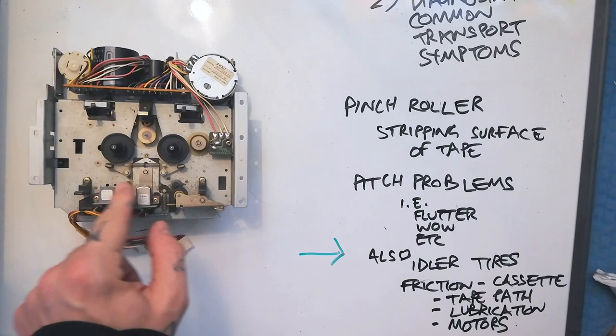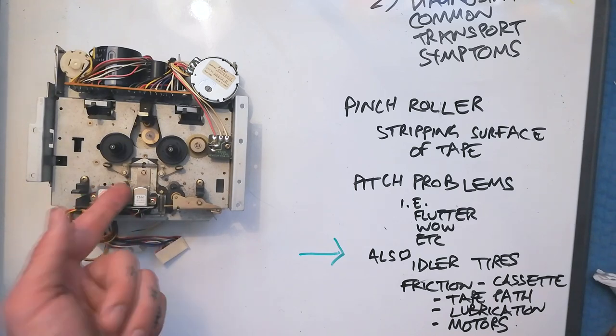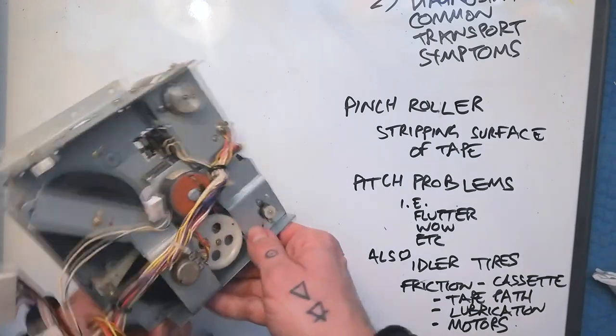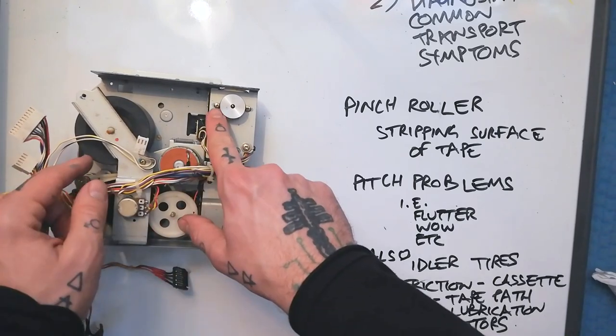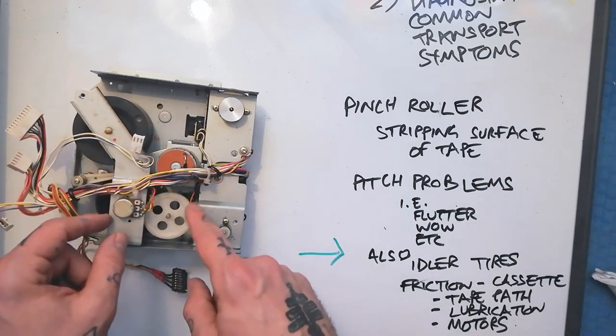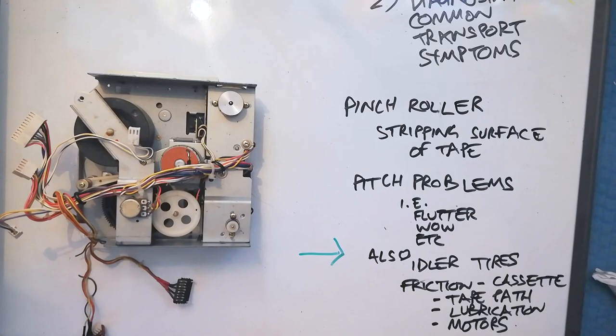It might be the tape path — how the tape is passing over these heads. There's a little metal lip either side of these heads and if the tape inside the cassette is rubbing against that, it can cause pitch issues. It could also be that some mechanism in here needs lubrication. Sometimes belts have been replaced but there's still goo or dirt from a previously deteriorated belt on these pulleys, on the flywheel, on this wheel — any dirt in the system can translate into a regular pitch fluctuation. Sometimes there's internal friction in the motors themselves; a little oil like you'd use on a sewing machine can help, but sometimes the motors need to be replaced — though that's an absolute worst case. If you're having pitch problems, make sure your pinch roller and idler tires have been replaced and that should certainly improve matters.